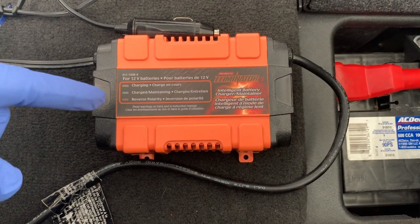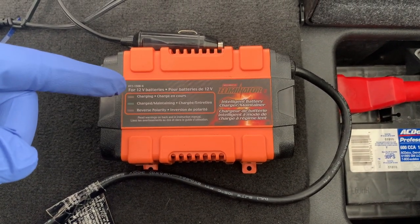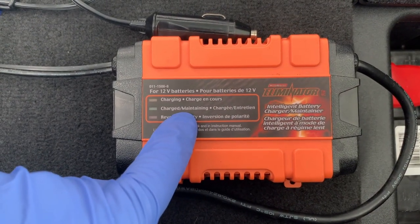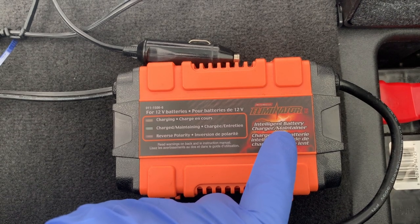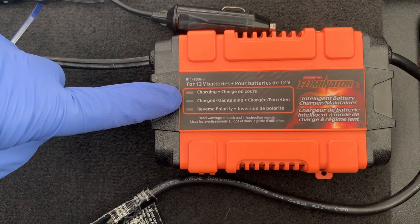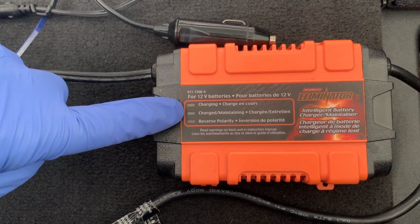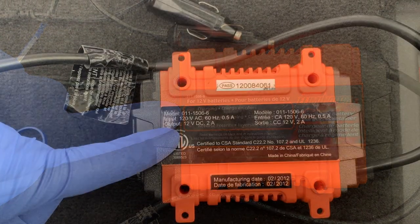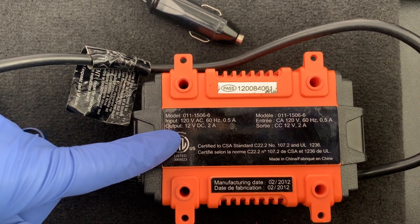Let's review some key features. I'm not promoting this particular brand — you can source whatever fits your needs — but make sure it has some key requirements. First, that it's ideal for charging and maintaining your battery. It should also have a built-in intelligent microprocessor, which makes charging a lot easier and safer. It should automatically switch from full charge to maintenance mode to maintain the battery during prolonged periods of storage without overcharging or damaging the battery. This multi-stage charging provides a more thorough battery charge. Make sure it's suitable for all types of 12-volt lead-acid batteries, and the bonus would be including gel cell and AGM.